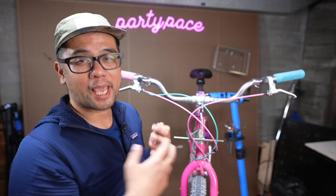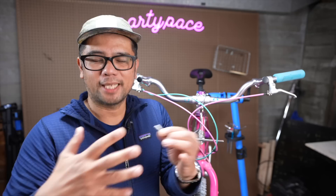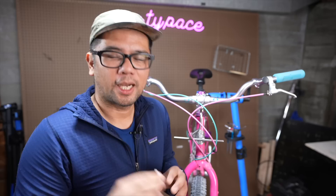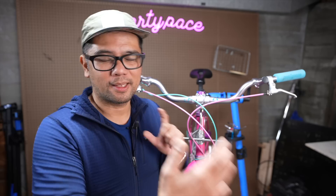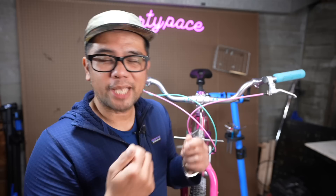For example, you've got a bike with internal cable routing and the cable is too short because you want to raise the handlebars. Maybe you're switching to a wider handlebar setup and you just don't want to deal with pulling all the cable housing out and re-threading it through. With this, you can nip it off at the bud, set up your new controls, and instead of changing the entire length of housing, just change that shorter segment attached to the handlebar. Another instance where this could be handy is swapping out the rear derailleur. Older derailleurs use a long, lazy loop from the frame into the derailleur; some newer ones, especially 1X-specific ones by SRAM, have a really short and direct housing run — a pretty significant difference. So you can splice in that extra loop or remove it for a more modern rear derailleur.